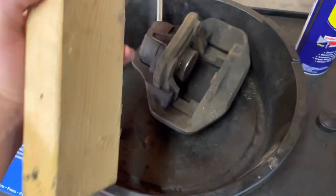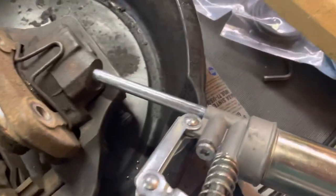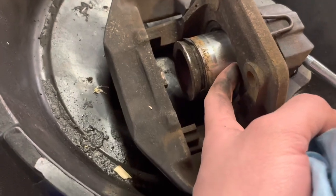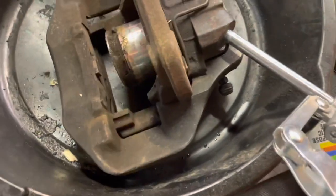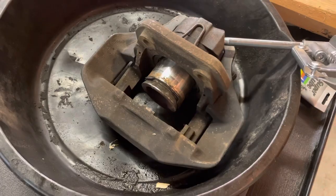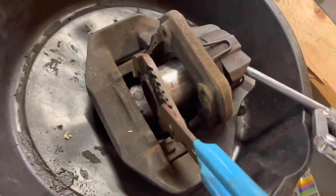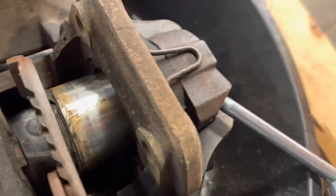You don't want chips off the wood going into the cylinder of the caliper as you could get scores. We've now got the piston almost all the way out. At this stage it should go with a little less pressure, as when it meets the end of the piston it should usually just kind of fall flat onto the ground. Cover it up and make sure you don't get any liquid at you — and wear safety glasses for sure. Sometimes they're stubborn at the end, so if you take a pair of channel locks you can get them. The key is to grab the channel locks on the part of the piston that mates with the pad, not the part that mates with the cylinder of the caliper.